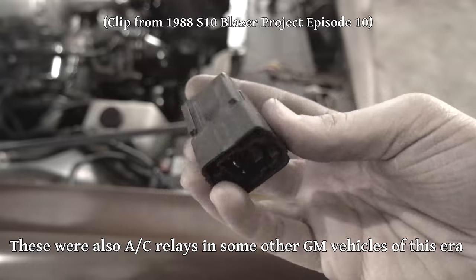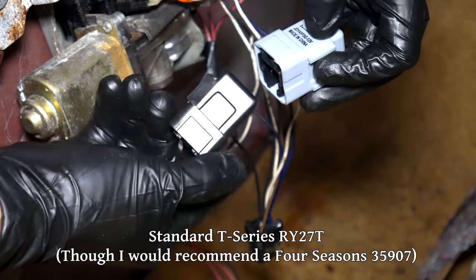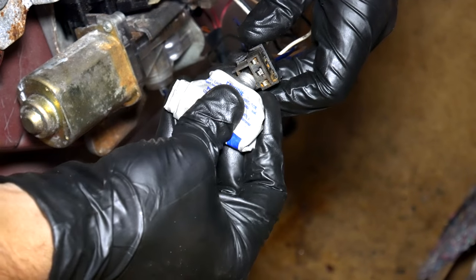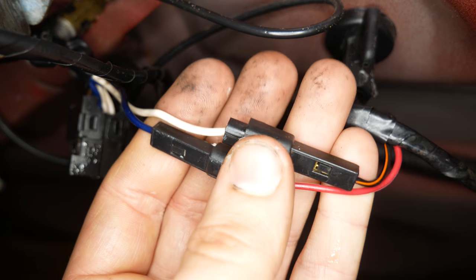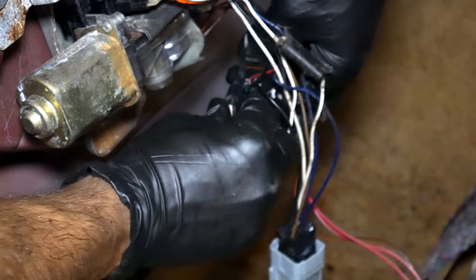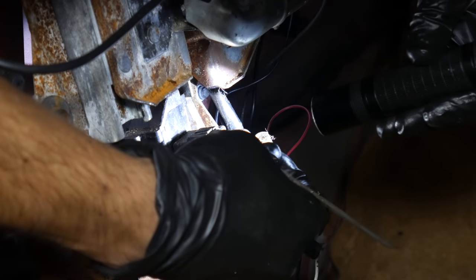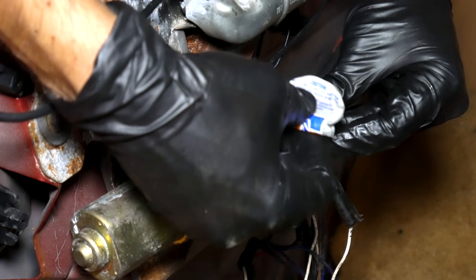I looked all around and was completely unable to find a replacement relay listed for this assembly, but luckily I recognized this as being the same relay that GM used for the fuel pump in my 1988 S10 Blazer and just ordered one of those. Here's the crusty original relay versus our shiny-ish new one. I had gone through and very carefully cleaned the connector up with a wire brush and a little file so it's in decent enough shape to reuse. To hopefully prevent any future corrosion, we'll slather the whole thing with dielectric grease and plug in our new relay. Right near it in the wiring loom there are also two single-wire connectors - we'll apply some dielectric grease and reconnect them since they appear to be in good shape.